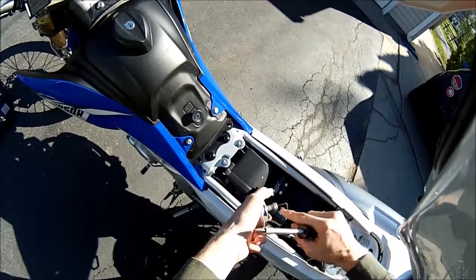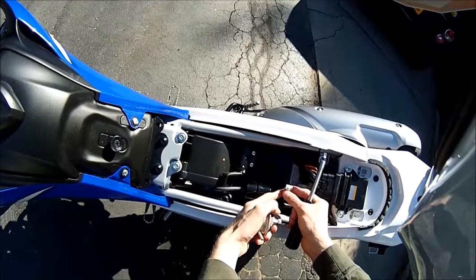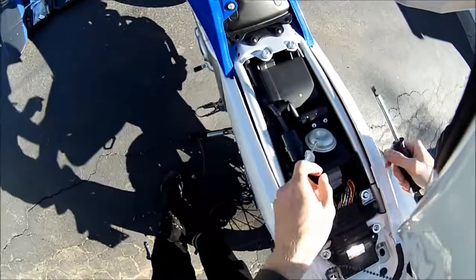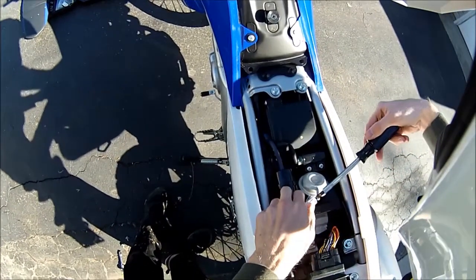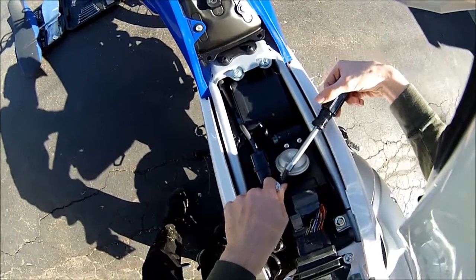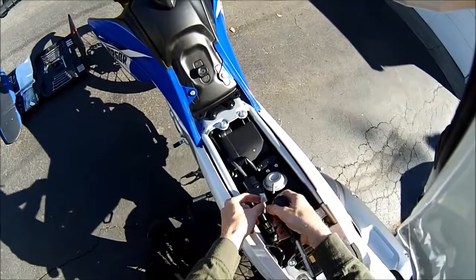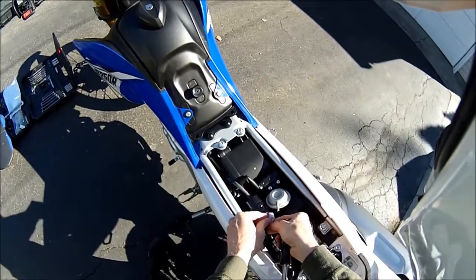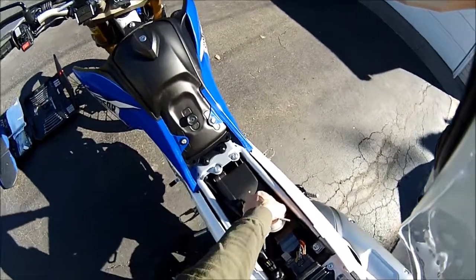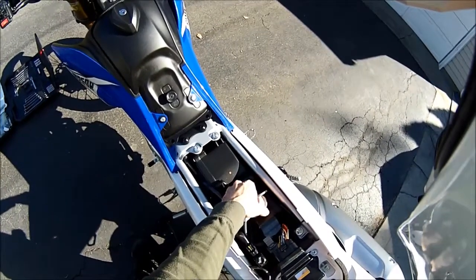There's a little connecting piece — a plastic circle and another plastic circle — and it slides through, and it's attached to this line. Basically what you do is first disconnect this line. It's on there pretty tight, so you slowly tug while prying and pushing it off. You end up with the line pulled out. This is where the duct tape comes in — take two pieces, wrap it around, close it, and put another piece on top, because you don't want anything getting sucked into that line. Then push down and twist to the left — you'll feel it unconnect.